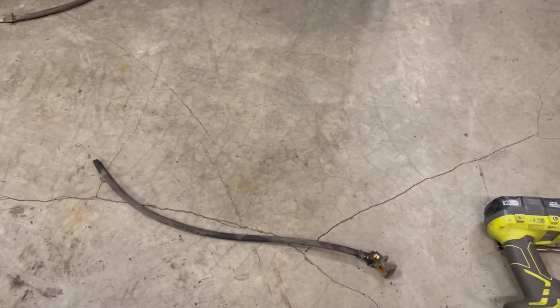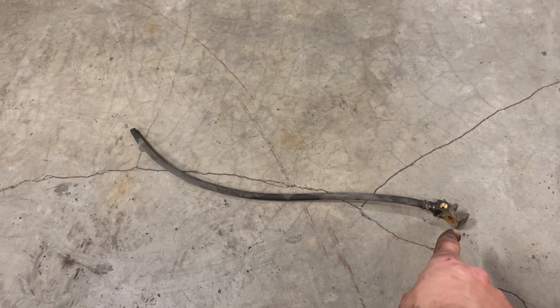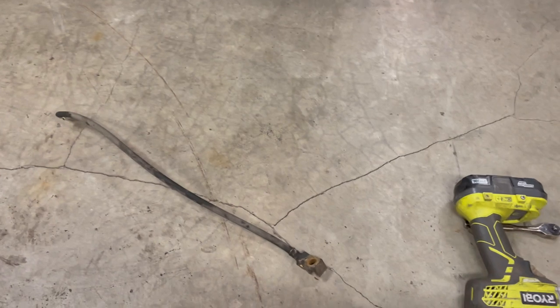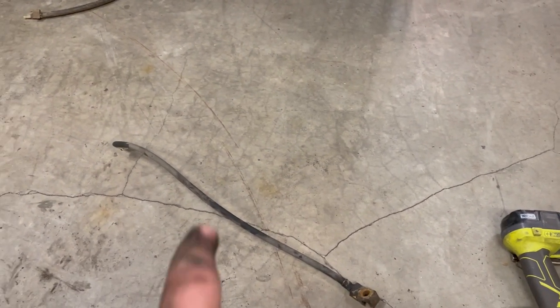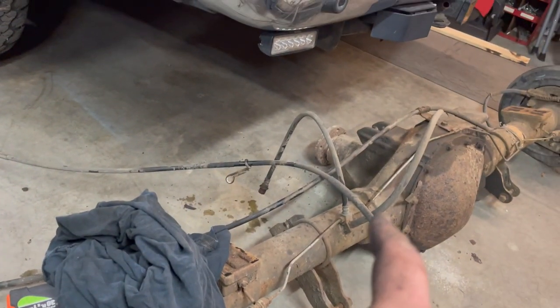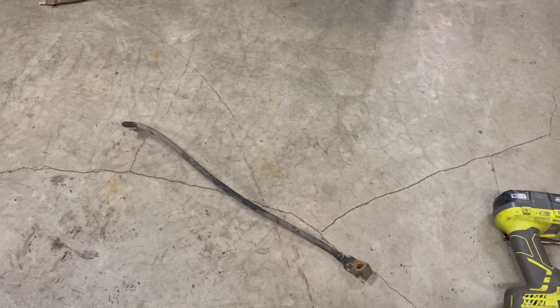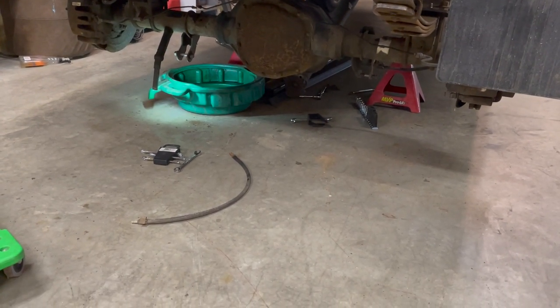I've run into my first part I've had to order. This is my brake line off that axle — it's attached through the vent. The vent tube actually has a thread on the bottom of it and goes right through the hole into the axle. Mine was cut by the guy that took the axles. I have one on order from Napa — it's $48. It is 24 inches long, while the stock Excursion one is 20 inches. That gives you room for four inches of lift just with a stock F-250 rear brake line — pretty awesome. When you're pulling your axles, try to use the original. If not, Napa has them and the local warehouse had them, so it'll be here tomorrow. That's the only snag I've run into.